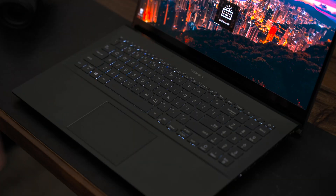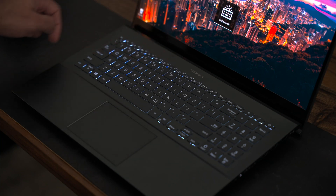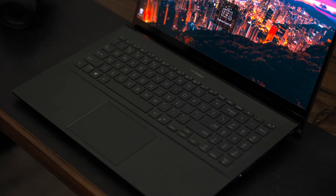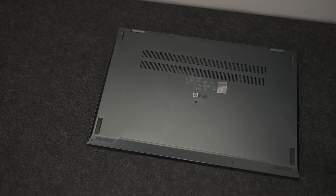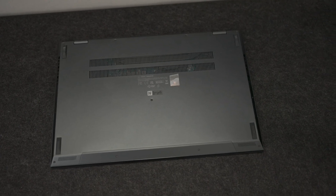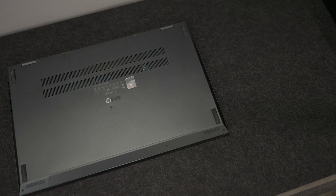In the function row you'll find a button to control the three-stage backlight on the keyboard. It's a really strong backlight, one of the best I've seen — it lights up the keys and rounds them pretty well. Unfortunately, there's not a ton you can upgrade in this laptop. You can flip it over, pop the feet off, undo the screws in each corner, and replace the SSD. That's really it — everything else is soldered on, including the RAM, which is unfortunate.